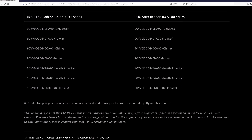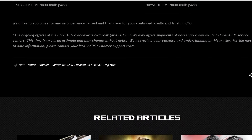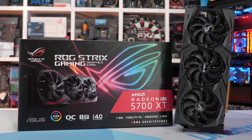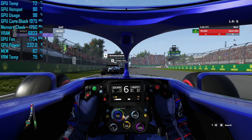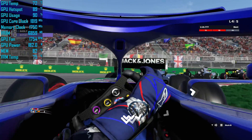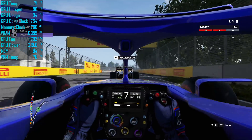But it has been a slow process, though that's not entirely ASUS's fault. A certain virus has stopped ASUS from acquiring the screws they need in large enough volumes. So at this point, yes, ASUS has acknowledged there is a thermal issue with the Strix 5700 XT and they will be providing customers with new screws to fix the problem. Here is a look at how my 5700 XT Strix card performs with the updated screws — we're now looking at a peak temperature of 72 degrees with a fan speed of 1800 RPM, which is a big improvement on what the card was doing previously.